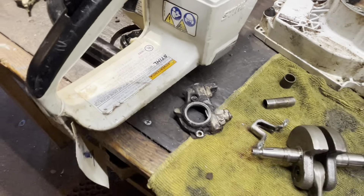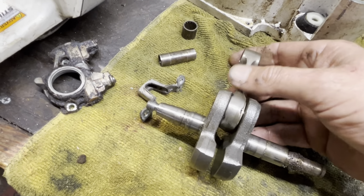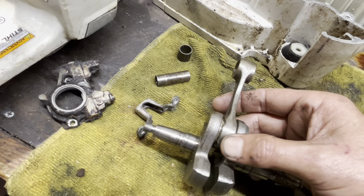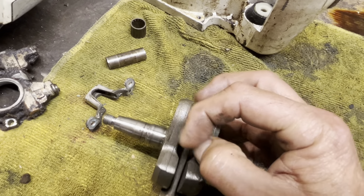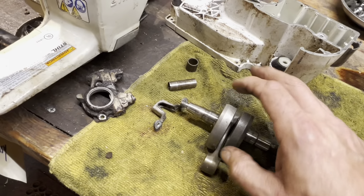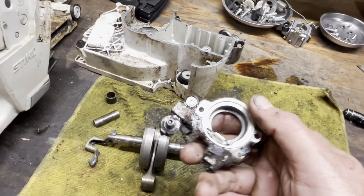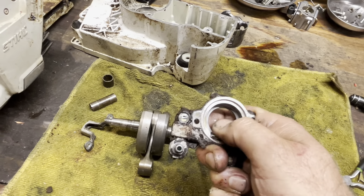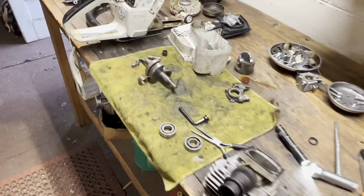Looking at the crank — there's no heat on the little end, no heat on the big end. But with all that debris, I am going to flush this in some gasoline and compressed air to get everything out. I did a visual inspection all the way around that large rod bearing for the big end and it seems fine. We're going to get all the debris out and make sure we're clean and good to go. And a little quick once-over — looks like it's doing okay. She's pumping.